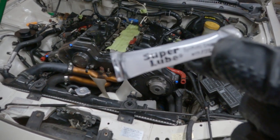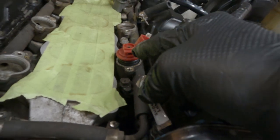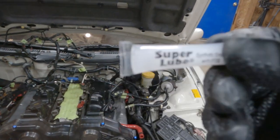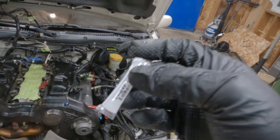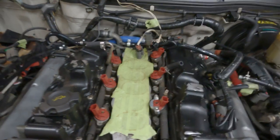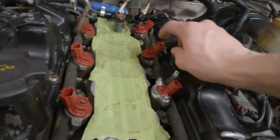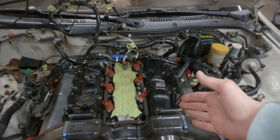The kit comes with these neat little super lube guys. What I'm gonna be doing is lubing up the O-rings on the new injector so that we can press it all the way down onto the fuel rail. With the injectors lubed up, they slid right in. These two dudes back here are still outside of the rail a little bit, but you can use the screws to push the injector into the rail. I like this kit a lot. Thank you, Z1.